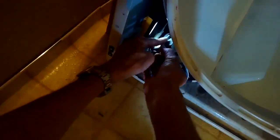So we got the screws out, we pull the bracket off, and then we can pull off these 2 coils. They're different sizes. There's a bigger one here closest to you where the terminals are down close to the valve. And there's a skinnier one away from you where the terminals are up closer to the tumbler. On the big one closest to you, there's also a small round metal piece that fits over the post. Sometimes that'll come off with your old coil, and you got to make sure you get that out and reinstall that on the post before you put in the big fat coil that's closest to you.